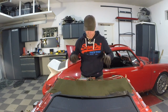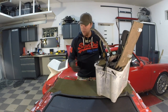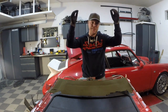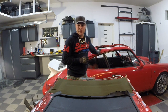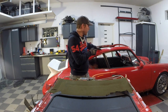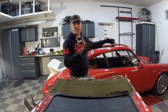The roof alone with the sunroof and the motor is 21 kilos. Together with a little pile of junk here, this is 25 kilos — quite a lot. In place of this 25 kilo contraption, it's going to go with a carbon fiber skin weighing in at about 4.5 kilos with glue and everything, meaning the weight saving going from this to carbon fiber skin is about 20.5 kilos. That's great because it's at the very top of the car, meaning it makes a difference — the right choice to go this path. In terms of stiffness, since this car is going to get a full weld-in roll cage, stiffness is not an issue because it doesn't rely on the skin. If you don't have a full weld-in cage and you try to do this, that would not be a very good idea because you'd have a big hole with nothing providing stiffness.